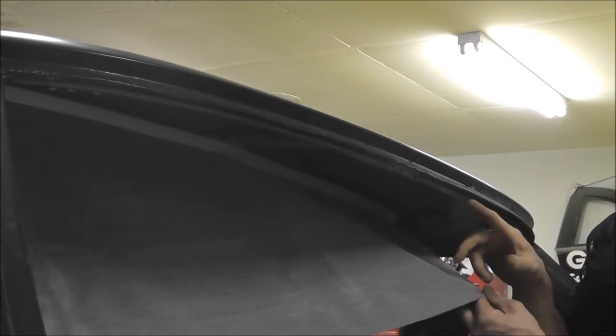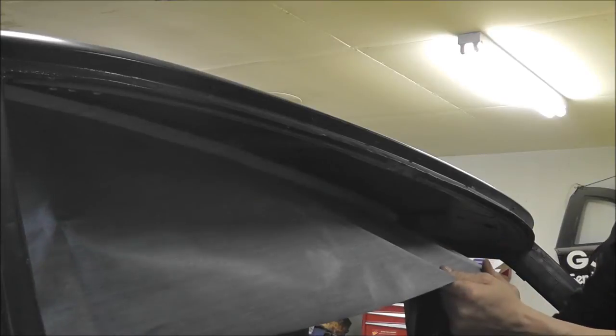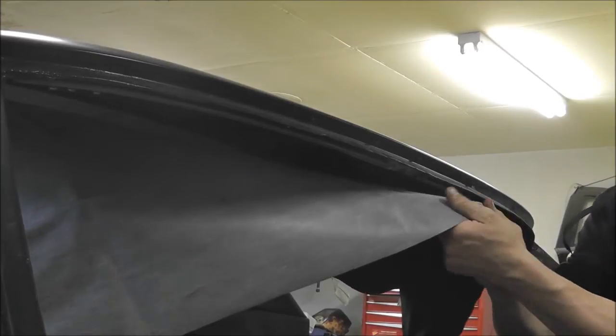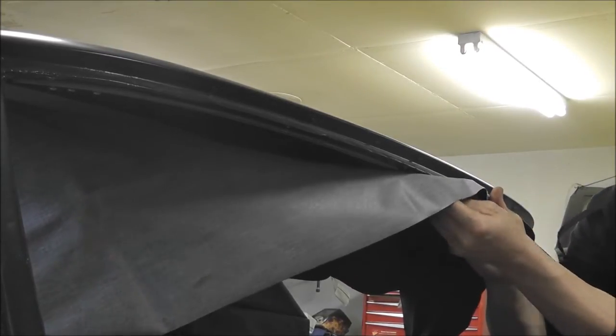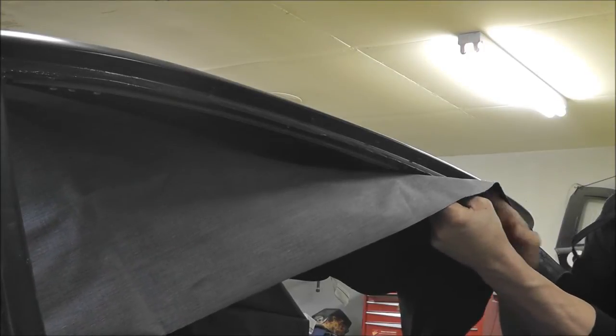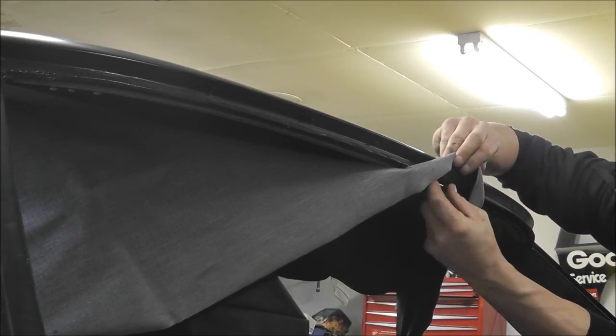That's installed. What I'm going to do now is, there's a tack strip just underneath the windshield pinch weld, or area where the windshield sits, and it's got little teeth where the fabric hooks onto it. You do have to glue the headliner and glue the tack strip, and then pull and push it in position. But I'm not ready for that stage yet, so I picked up some of these door molding trim pieces, and I just cut 4 of them. So what I'll do is pull it, and I'll just kind of hold the headliner in position with these pieces, and then when I'm ready to glue it, I'll just take them back off. This way it'll let me get the basic fit of everything before I actually glue all the edges on.